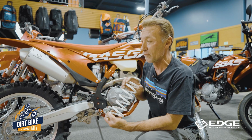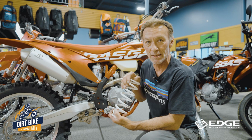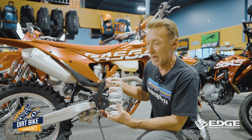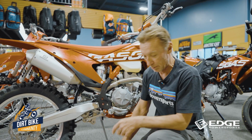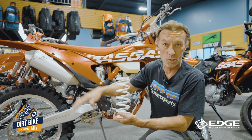We're actually going to delve into a bit more suspension in our next video, and talk a little bit more about how to adjust some of those things in a deeper method, with cause and effect. But it's super crucial to get the spring rates right. That way the bike's going to work for you properly and it's not going to want to launch you out of the seat, or be too saggy.